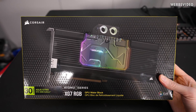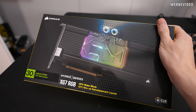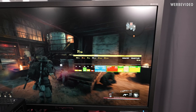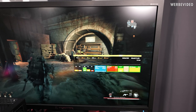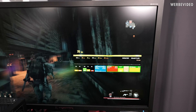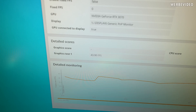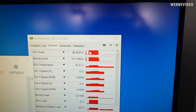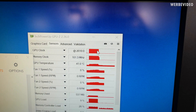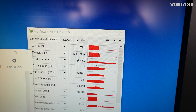They all share exactly the same PCB, that's why it should perfectly fit. It's also a new generation of the Corsair blocks with a different terminal than previously. I've never used one of those before myself, so I also want to test this out of personal interest. We're running Remnant from the Ashes as a benchmark in 4K with the Ryzen 9 5950X, hitting about 74 to 75 FPS average and about 55 FPS in the 1% low. We just passed TimeSpy Extreme GT1 after a 5-minute warm-up phase, scoring 43.9 FPS. The frequency in GPU-Z was about 2010–2025 MHz for GT1, and temperature was sitting at around 62–64 degrees Celsius.